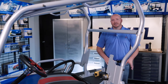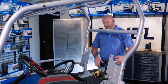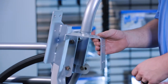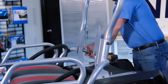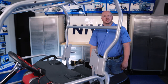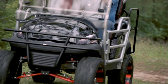At this point, if you're not installing a rear seat kit, go ahead and install your front seat lean backs using the retained hardware. If you're installing a rear seat kit, do so now — when you get to the lean back cushion step, swap out the lean back brackets from the seat kit with the one supplied with this kit, installing it on the lower hole using the remaining countersunk hardware. After that, install your front seat. At this point, we can tighten all of our hardware. Since we're not putting a seat kit on, we'll attach our front seat using the retained hardware. Once your seat is secure, you're finished installing your Jake's Baja Cage designed for the Club Car Precedent.